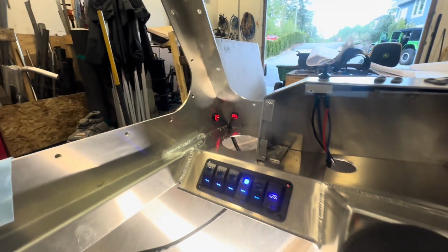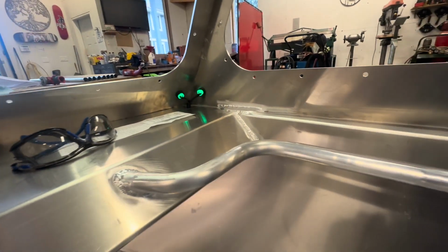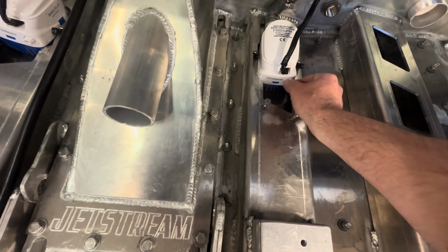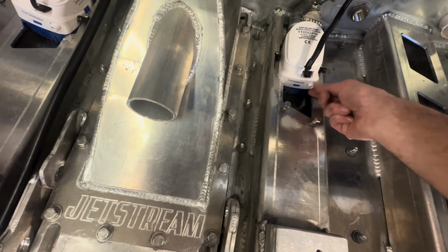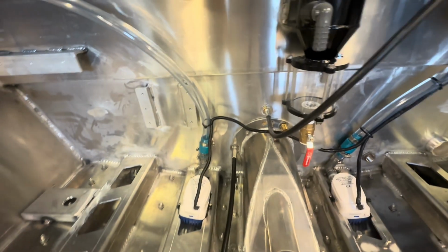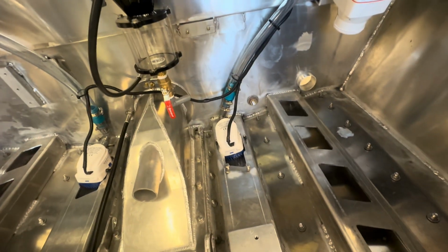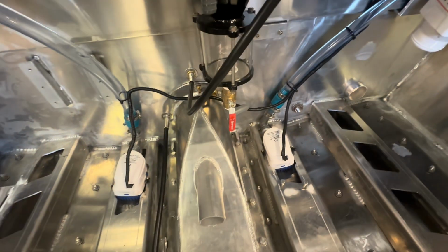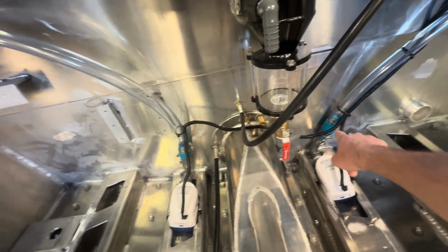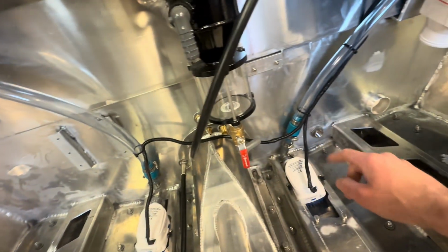Remember, they're little 1-inch nav lights, and this way I can actually see if they are running. And these are also automatic bilges, so if the float lifts up, they are already wired in, and you can test them. Just spin the thing as if the float's lifting. They are 1,100 gallons an hour, times 2, cut out of the stringers so they sit as far back and as center as possible. And I also put in one-way check valves underneath, just so that all the water that pumps out doesn't just fall back in.